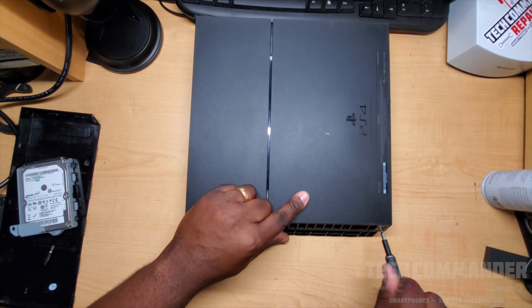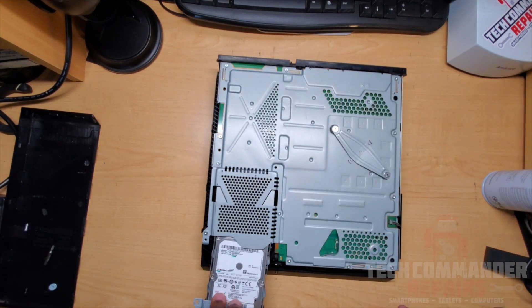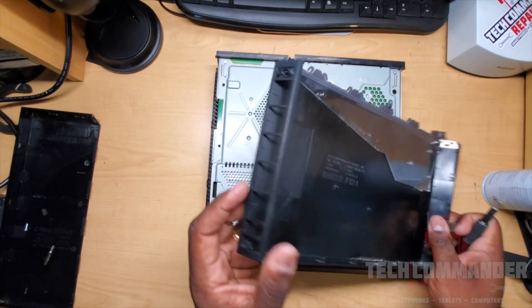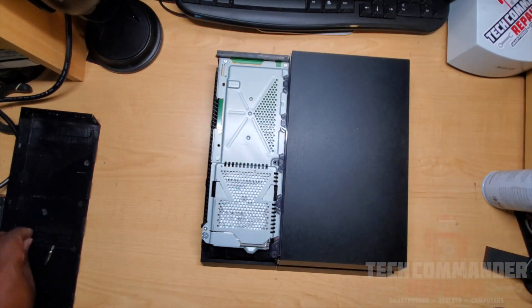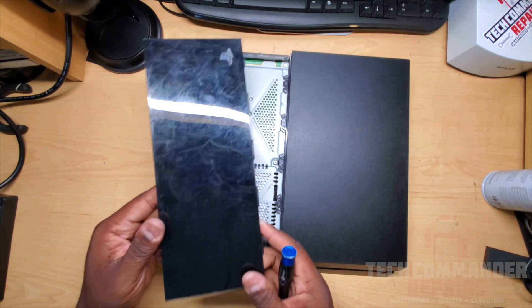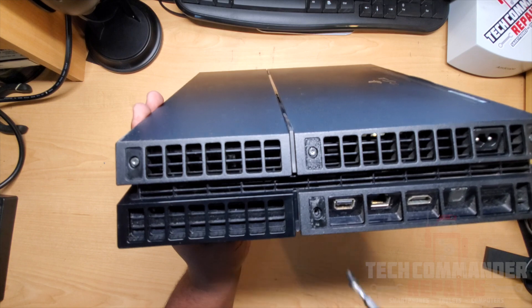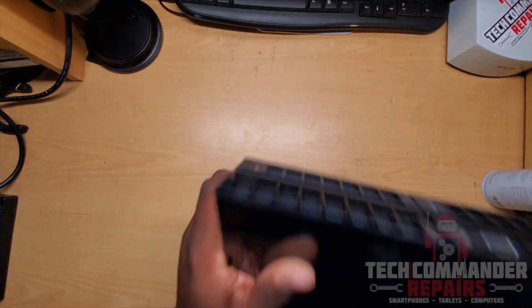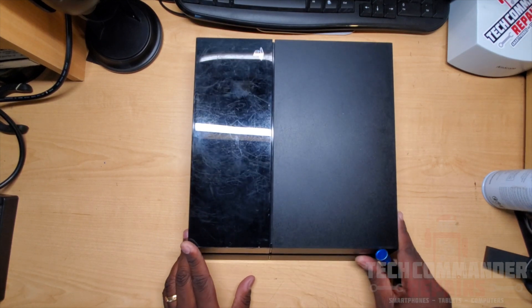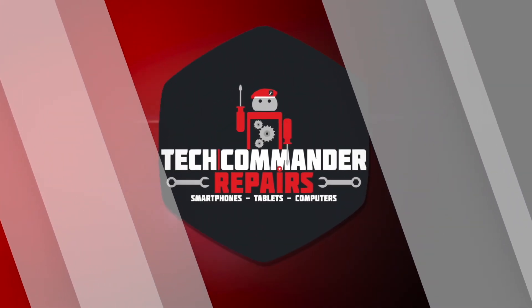You can now add the bottom housing and screw in three of the black T8 screws. Flip it over, add your hard drive caddy and screw that in with the Phillips screw. Put back your top housing — the little openings go to the back of the PS4. Slide it on the back, push it down, screw in the two T8 screws, and slide on your side cover. Finish it off by screwing in the last black T8 screw on the back, and that's your PS4 teardown and reassembly. If you liked the video give it a thumbs up; if you didn't, leave a comment. Leave any future repair requests in the comments below — until next time, see you in the next repair!